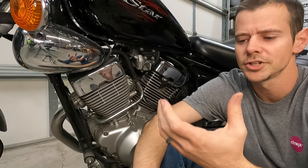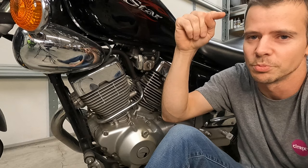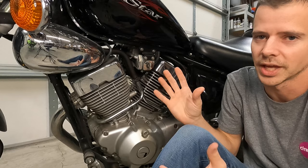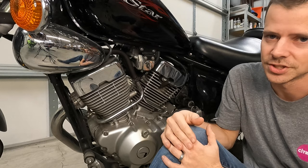A quick example for how a petcock actually works: picture you've got a cup, like you're at a fast food restaurant. You've got a cup and a straw. If that straw is pulled halfway out and you're drinking, eventually you're going to start sucking up air and no longer your liquid. You push your straw down a little bit lower and you can drink a little bit more. The purpose for that is that this bike doesn't have a fuel gauge, so you don't really know when you're low on gas unless you're counting your miles. So the idea is you turn to on, and when your bike dies, it's because you're getting low on fuel. You can switch it up to reserve to start it and get to the gas station to fill up your tank.